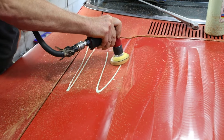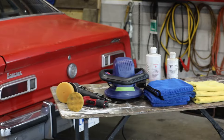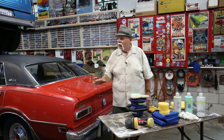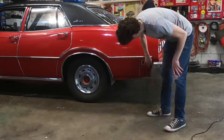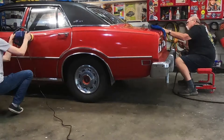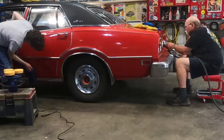We've done the wax and it looks incredible. I want to reiterate: this is not in lieu of painting your car. The average paint job is now five to seven thousand dollars — if you think you have paint on your car that is restorable, polish it first. This is an easy alternative — you're looking at maybe forty to fifty dollars worth of product. If you already have a polisher, do your car, take your time. We've done this over the course of about an hour, one stage at a time, and the car has gotten progressively improved over each one of those processes.